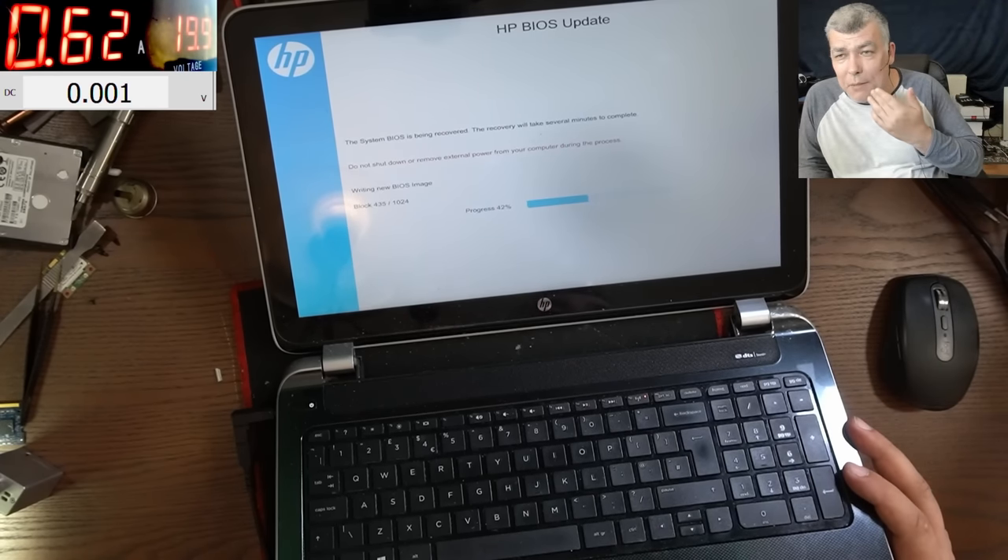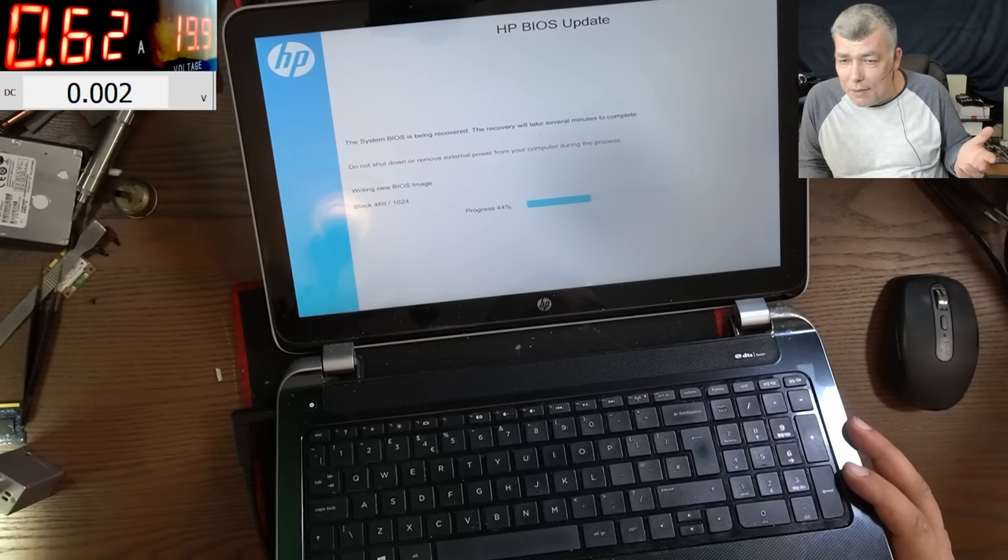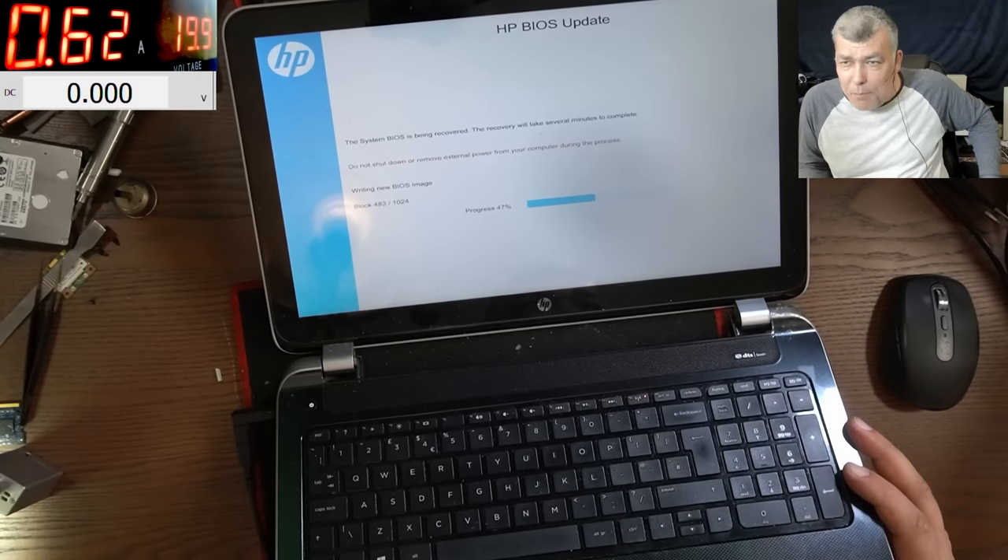Something doesn't make sense — this is not a slow boot, this is a damaged BIOS. I was misled by what they said. The problem is, the customer probably told them that, so it's an entire chain of misleading. But the BIOS was corrupt — that was the reason for the two flashes on the caps lock. And you don't even need a programmer for HP — you just plug the USB and you recover the BIOS.